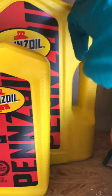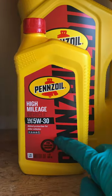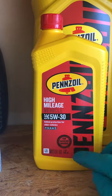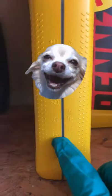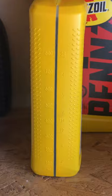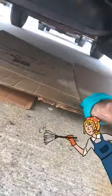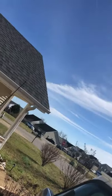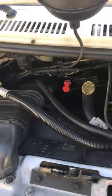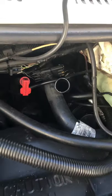My engine takes five quarts, and just a little bit more — maybe about 300 milliliters more, right about here. I don't want to get the ground dirty so I need this cardboard underneath. Before you start draining your fluid, go ahead and pop the hood and remove the oil cap so the oil can drain better and faster, because it gets air going inside the crankcase.